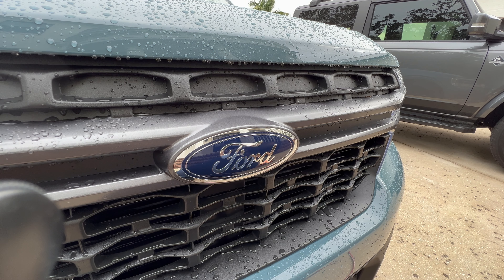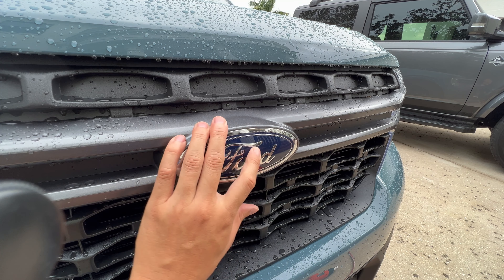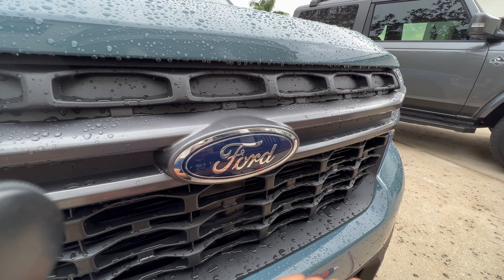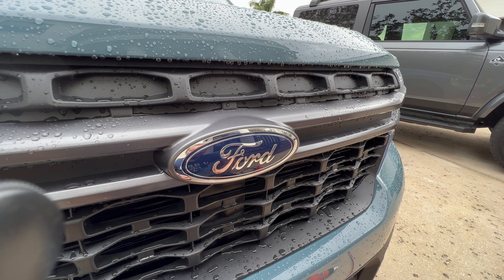Because it's about 70 degrees, I do have a heat gun out here. It'll help dry up that soapy water and get the adhesive really sticky again by using heat. If it's really hot, I would definitely not park this in the sun — even if ambience is between 70 to 80 degrees, everything will heat up faster than you probably expected. It's easier to do it in a warm environment in the shade, but then add heat with the heat gun or hairdryer so you get to control how much heat you add.